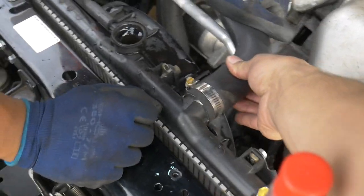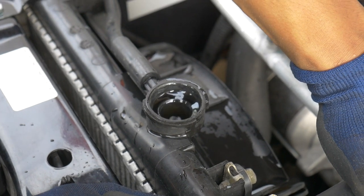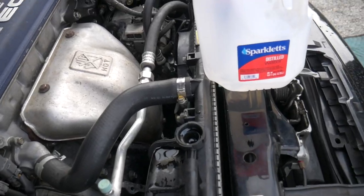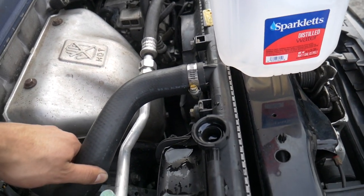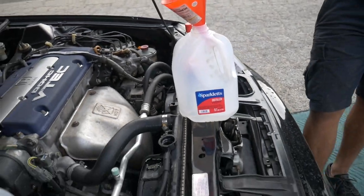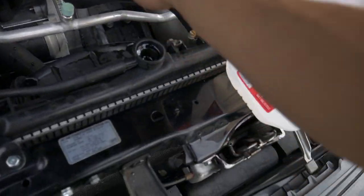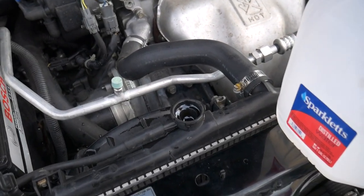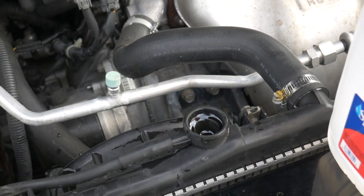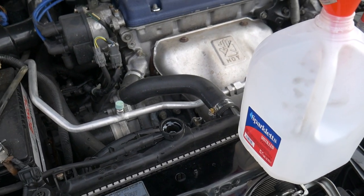It's a good tip to start squeezing the radiator hose because it'll pop a lot of the air bubbles out. Right now we've got a good amount of water in his radiator but we're having issues getting the water down, so what Matthew is going to do is start the engine. Once the water pump starts going, it'll start pushing the water through and we'll see a lot of the air come up on its own through just the idle. You can blip the throttle a little bit to make it quicker, but it's usually not necessary. Once it's done, we're just going to top it off and then add the water wetter.